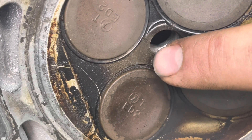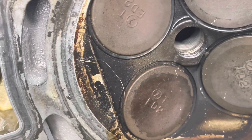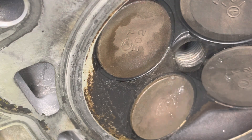As you can see, there's light cracking here, here, and here — that's not what you want to see, especially on the passenger side head. There's also cracking here and here. Something like this that's 20 years old and has seen millions of heat cycles will show some cracking. The bigger issue was that cylinder one had 18% leak-down and cylinder three had over 45% leak-down, with leakage coming out of the intake valves — which corresponds to that cracking.